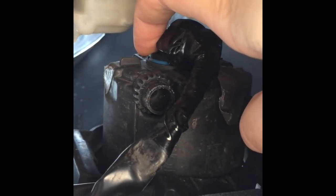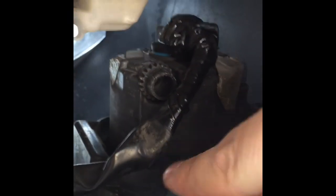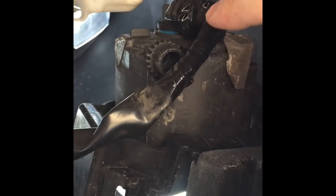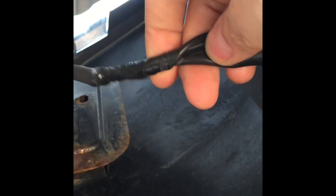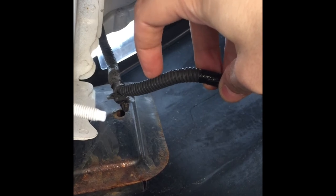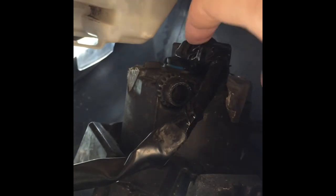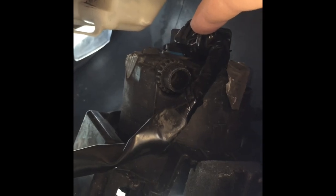If any water comes in here, it will not get into the connector or the bulb. We sealed the rubber cover for the electrical wires to protect them from damage — there was a little gap between the connector and the rubber, so we sealed it. We also resealed the connection between the thick rubber and the wiring tube, which is a continuous soft tube that allows the wire to bend easily without damage. We're putting this connector back but first retesting the bulb to make sure it has no flickering or connector problems before finally resealing and reinstalling everything.